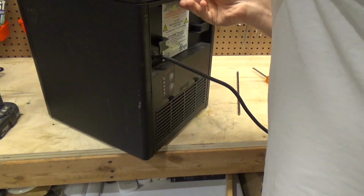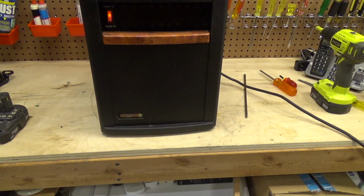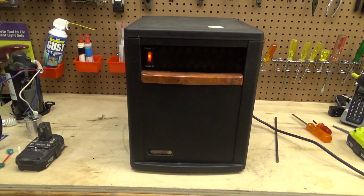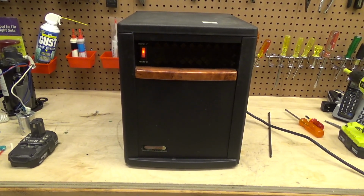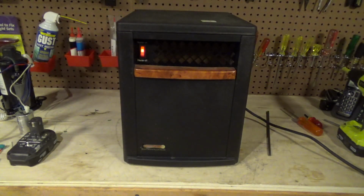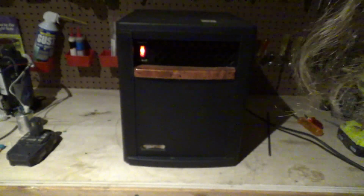You can hear the elements, and it's pulling 811 watts, which is right about what would make sense. Plus the addition of the fan should give us right around 900. And it really doesn't glow orange like it claims to in the photograph, which admittedly is kind of disappointing.